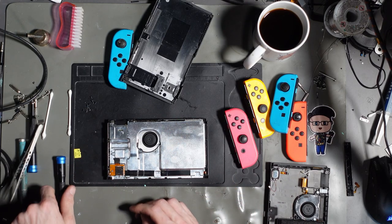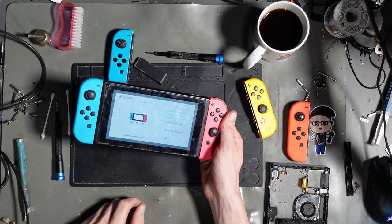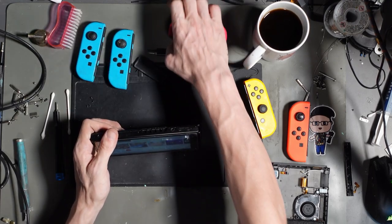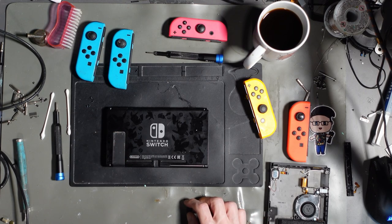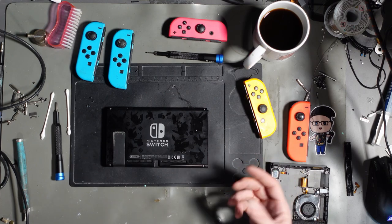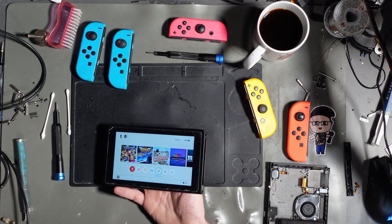I'm taking that as a win. I tried my best — that's the main thing. They're both connecting, fans are working, job done. So whenever these have a Joy-Con connection issue you also need to look into whether the fan is spinning. If you're going to replace the Joy-Con rails, before you do that just take the heatsink off and then just run the Switch for a minute or two before you go out buying new rails. Because most of the time if both of the Joy-Con rails are not charging the Joy-Cons, or they're not connecting when the Joy-Cons are dead, chances are you've got a fan issue and the chances are it's a MOSFET issue.